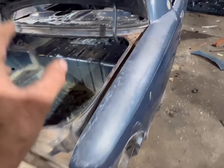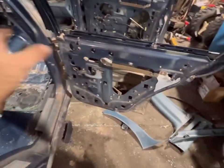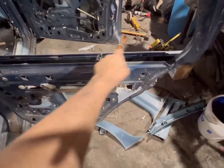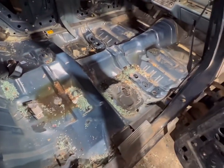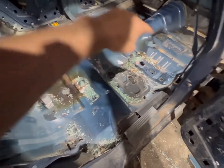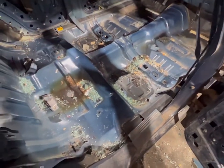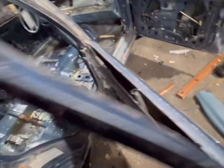The rear bumper is off. We gotta take the speakers out. This is just a wire class car so it doesn't have to be perfect — we stuffed all the wires inside the doors, cut the little window things off, and we'll vacuum the inside of the doors before we bolt the seat down. There are three half-inch bolts and one three-quarter-inch bolt per front seat. Slide the seat all the way forward to get the back ones and all the way back to get the front bolts. I'm just gonna leave all the seat belts in. All the carpet just peels up once you get the seats out.